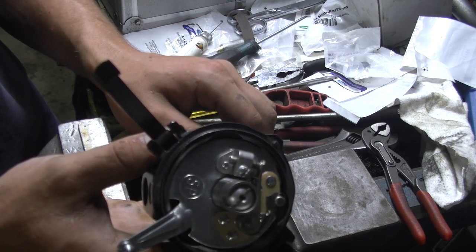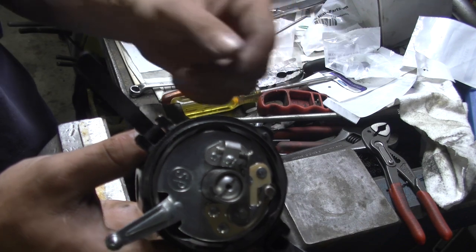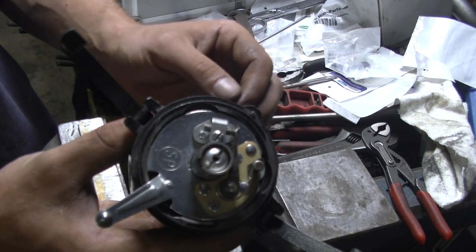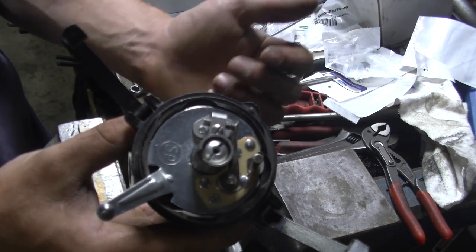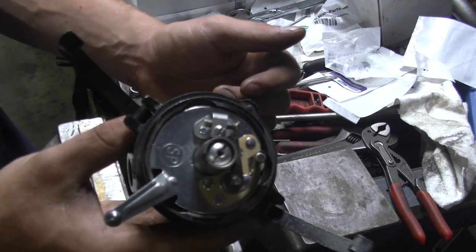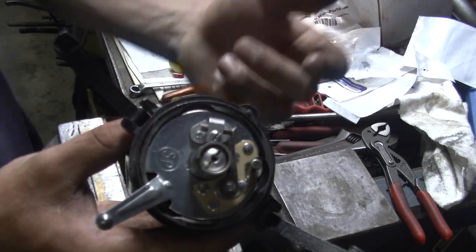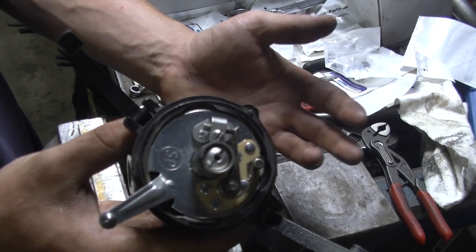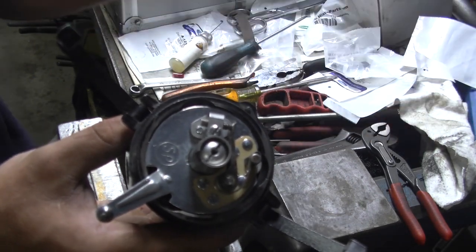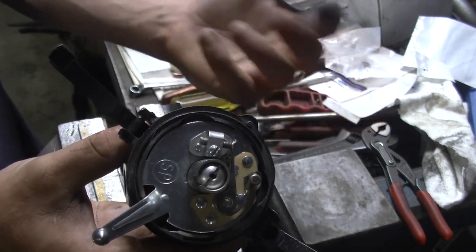There are keys, there are tools for it, but it's even more interesting to just look at the cam, the rotor cap, and the contact point. Of course, a light and everything would work as well, but if you don't have that with you, it's probably better if you can do it by hearing, and by what position the rotor cap is in. If that's in the right place, then you can easily push it a bit forward or pull it a bit backward to get it a bit earlier or a bit later, to get it right on time.